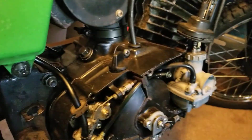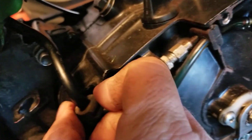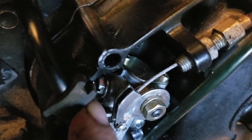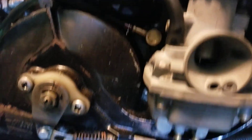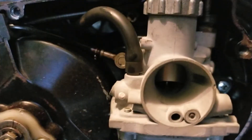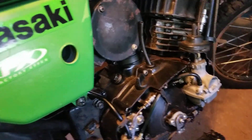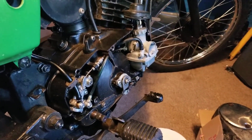Sometimes if they don't prime up on their own, you pull back this tube. There's a cap screw right there on the top — you can access it through the hole, take that off, that's the bleeder for it right there. Then you can see the throttle — your throttle should be all the way down like that. Make sure it's all seated in the cable. So all good right there. This is the KDE build, coming along quite nicely. I can't wait for it to be done.